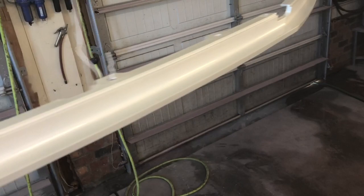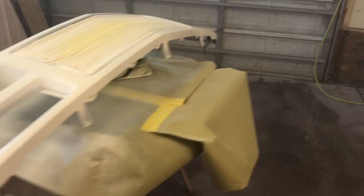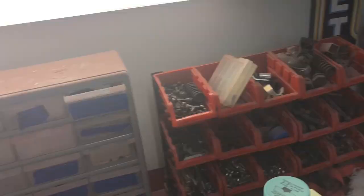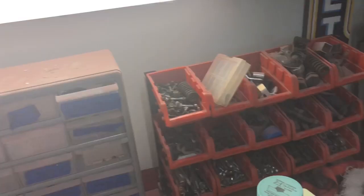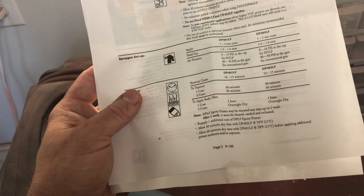I haven't talked much about which products to use because frankly I'm not a professional — I don't have any automotive body or paint experience. I'm a technician but I learned all of this myself in the garage watching videos and trial and error. For this sealer I ended up using a PPG product — it's actually an epoxy primer but you can mix it to spray as a sealer. The mix ratio was 2:1 with a half part acetone. The material data sheet says to top coat after 60 minutes, so that's what we're going to do before spraying the base coat.